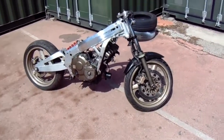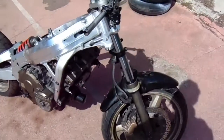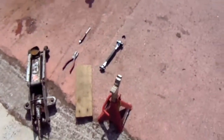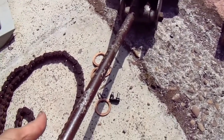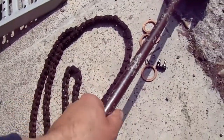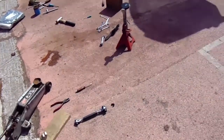One front end removed, greased up, cleaned, and put back on - lovely and smooth now. Bit of advice: if you've got your bike on two axle stands and a trolley jack, make sure your hands aren't full of grease. Because when I tried to lower the trolley jack after I'd moved the axle stands to one side, my hand was just slipping on the bar from the grease - I couldn't turn it. So I had to jiggle around and balance with one hand while doing the other.